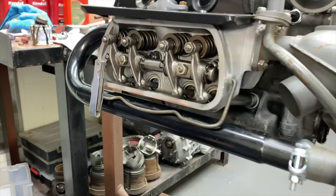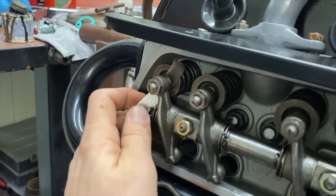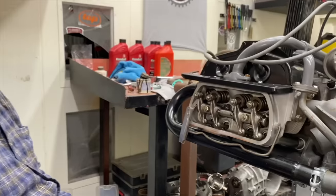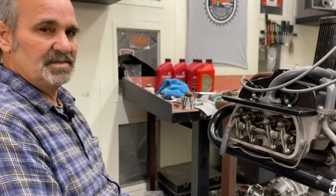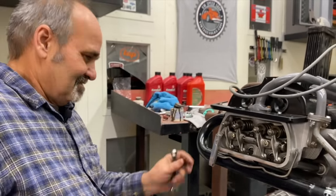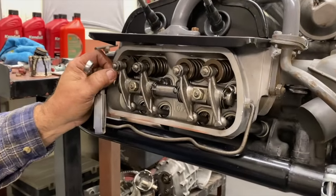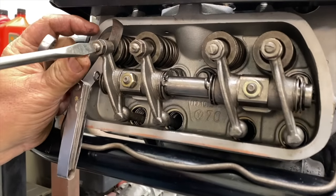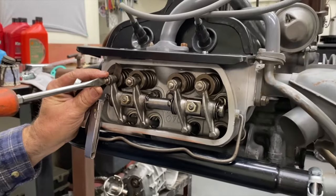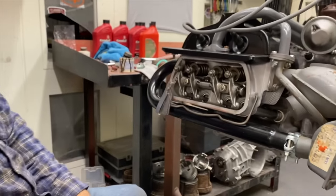Do those gauges wear out after a while? Oh, yeah. Now, you see what I'm doing right here? I'm setting these valves. You know how many years Scooter came behind me and checked this every time I tune a car up? How many? For 5 years. Really? He'd pull every spark plug out, check the gap, and he'd check every valve. Wow. Just a quality control. Finally, one day, I'm like, dude, are you ever going to stop and just let me do it? And after that, he let me do it. That's cool, man. He just wanted to make sure it feels exactly like he wants it to feel. Just like I'm teaching you, that's what you want to feel.